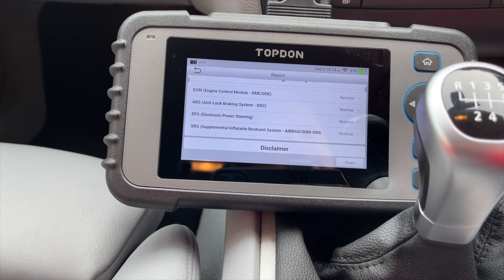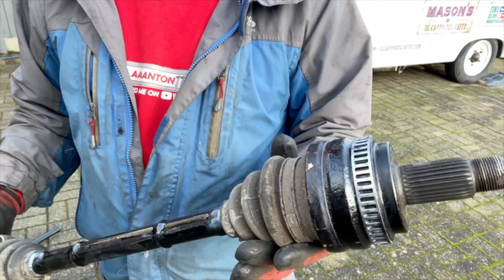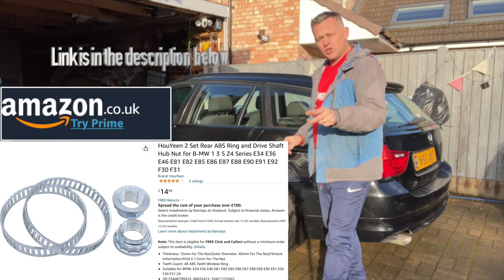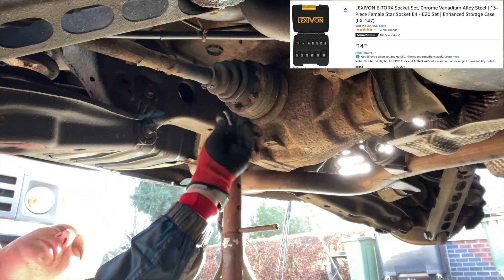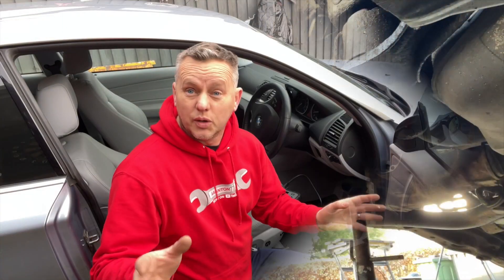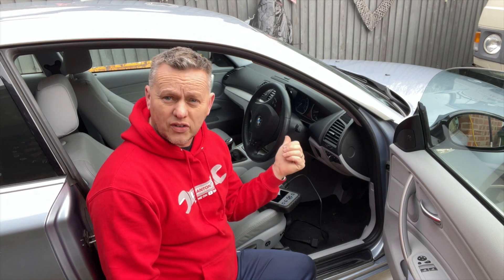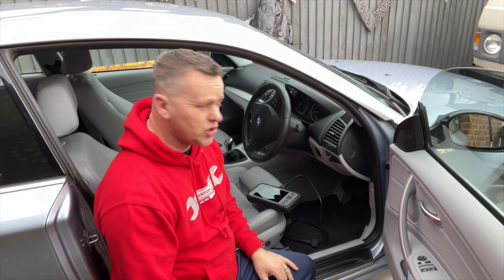All good - fantastic. If you're still having problems, I've got this video - I'll put links in the description. This is on a 3 Series, replacing the ABS rings from the back of the drive shafts, but the job is identical to the 1 Series. There we go - 1 Series is all sorted, running as good as gold. That little sensor at the back is now spaced out with that little shim. It's lifted it away from the ring, it's not catching anymore. We've cleared the codes - everything is absolutely fine. It's driving like a beauty.